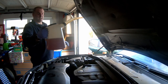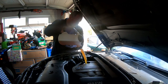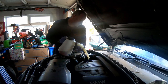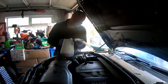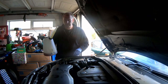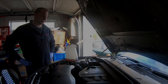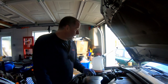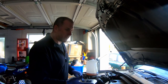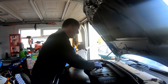Okay, what have we got in there - not even two litres yet, so let's carry on. Obviously you don't want to overfill your engine because overfilling it is just as bad as underfilling it. We've got about four litres in there now, so put the cap back on, let that drain down to the sump and then check the level on the dipstick. I've just checked the level - we're good, it's up to the max. In fact it's ever so slightly over the max but the front end of the car is up in the air so all the oil is at the back of the sump. I'd expect it to be on the max once we lower the car down, so I'm happy with the level. I'll close the cap up and that job's done.